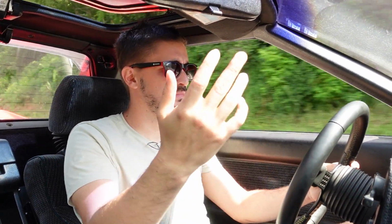Okay. But honestly, I'm impressed. It's drivable. And I mean, the turbo now isn't hooked up to boost control. It's directly hooked up to the wastegate actuator. So whatever the stock spring boost of the Max Speeding Rod turbo is, that's the boost we're getting, which seems to be 7-8 PSI.